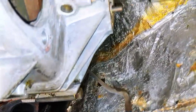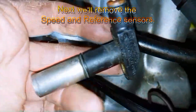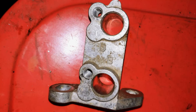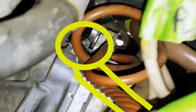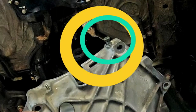Going back towards the top, remove the speed and reference sensor on the top of the bell housing. Remove the sensors from the bracket held with a 10mm bolt each, then remove the bracket from the bell housing held with two 6mm Allen bolts. While on top, remove the top bell housing bolt — it's a 19mm bolt. You might be able to get the second top bolt, or at least break it free, then remove it from below using a long extension and swivel socket. Leave the bottom bell housing bolts in place for now. Also disconnect the ground connection at the top of the bell housing — there are two grounds, one from the main harness and one from the braided ground wire that runs to the firewall.